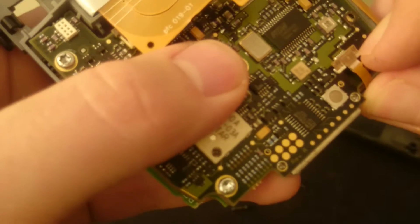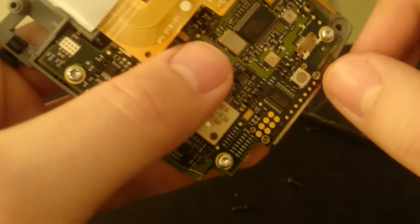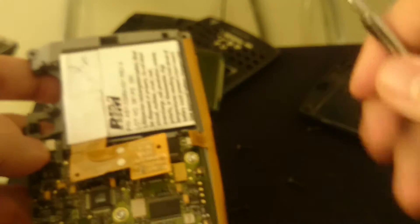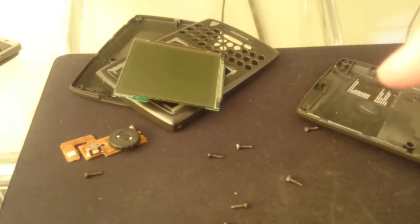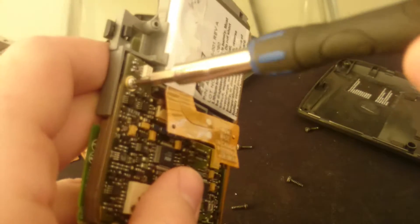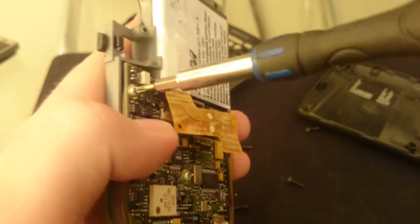And there's the antenna and flex cable there — remove that, and remove this connector here. Now we need to use a different screwdriver — it's a T8 screwdriver for these other screws. You can't mix them up because those are black and these are silver, so a few screws here.